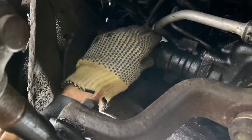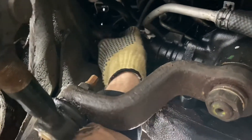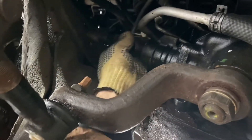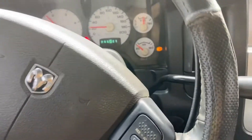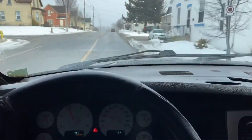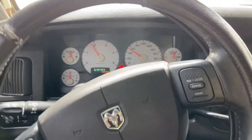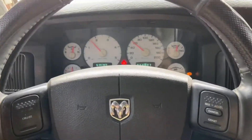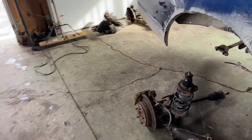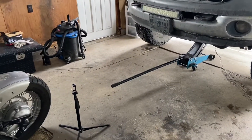We're right back to where I thought it was. Looking at the steering shaft, I've got probably over an inch of movement at least before it even starts to harden out and try to move the pitman arm. Everything seems to be moving a lot better and I'm holding a little bit straighter going down the road, but there's definitely still a ridiculous amount of slop with no reaction. So we're definitely going to need a new steering box — we'll order that up this week. Hopefully we also get our 10-point socket in so we can continue on the all-wheel drive EM2. Thanks for coming, guys.